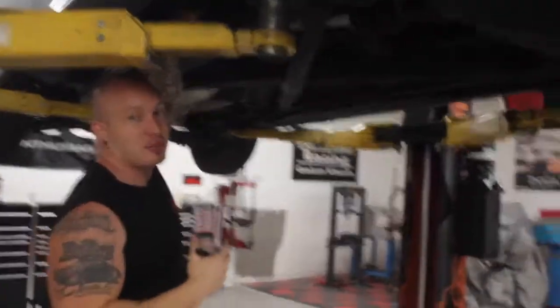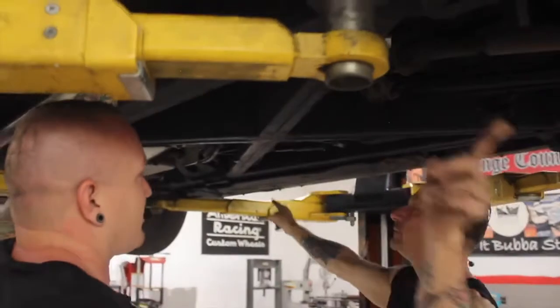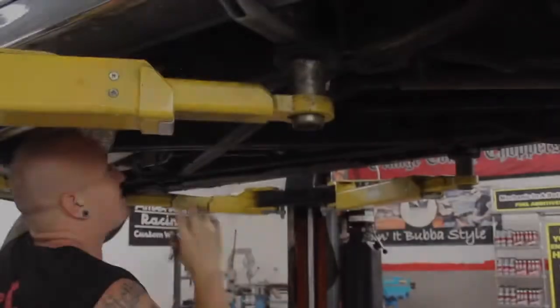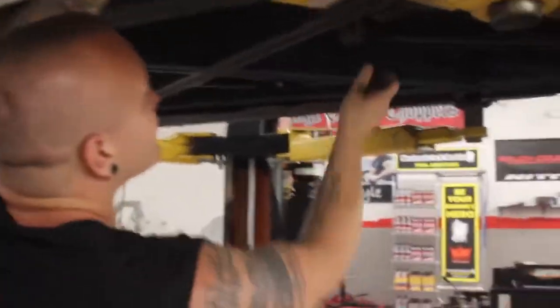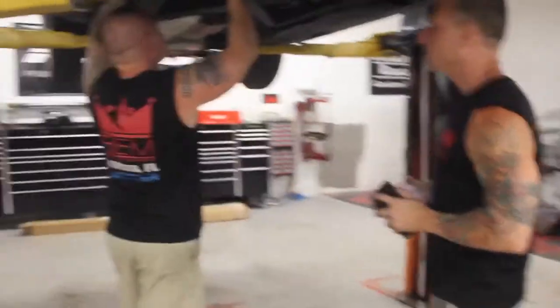What you'd consider an X-frame chassis on these Rolls-Royces — and a lot of earlier model vehicles as well — they're super, super strong in terms of their structure, but extremely heavy frames. These things have a setup where, because it's an X-frame, the exhaust is typically channeled through openings in the frame itself. You've got to channel all your bends through that and make sure you have perfect clearance all the way around so there's no rattling or vibrating. Can you give us an example of another X-frame style vehicle, particularly an American style X-frame vehicle?